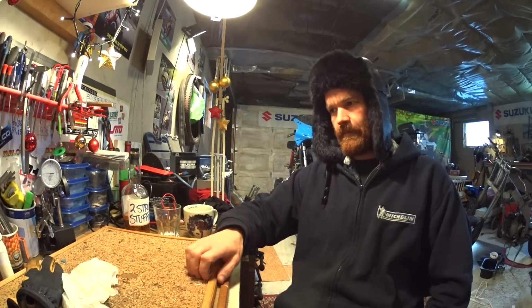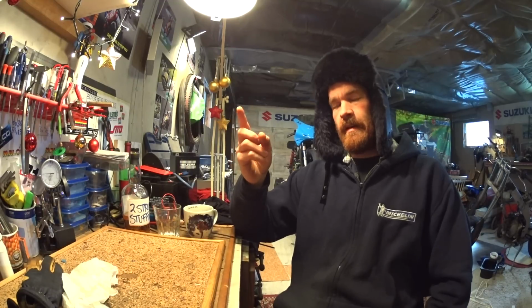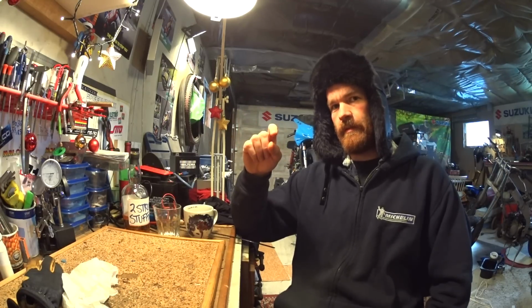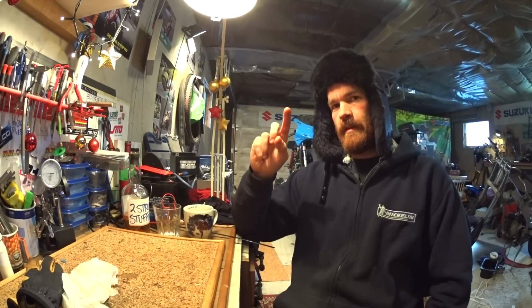They are making a new unit, one with 5 and one with 8 programmable points. So now it's 4 RPM points you can choose the ignition timing on. They are going to send me the unit with 8 programmable points for testing.